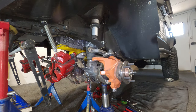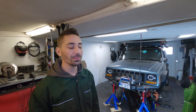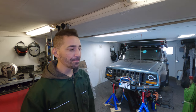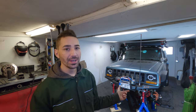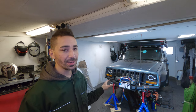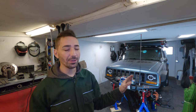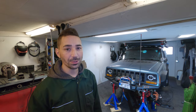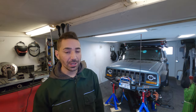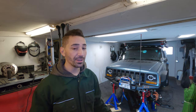That's it for this project for now. I'd have loved to have it all welded up, painted and looking good, but I'm just not there yet. I'm probably going to get the parts I just made powder coated — minus the crossmember. In the meantime I've got to pull the Dana 30: truss, C gussets, spring perch adjustment, shock brackets and the sway bar all need to be done. Then it needs to be cleaned, painted, and rebuilt with new seals, and I might as well check the bearings while I'm at it. All that will be done in the next video. Big thanks for watching — I appreciate all your support, and for my Patreons, thank you very much. I'll see you again very soon. Take care.